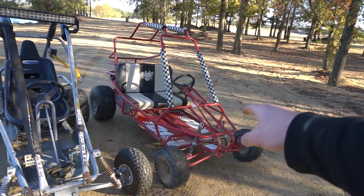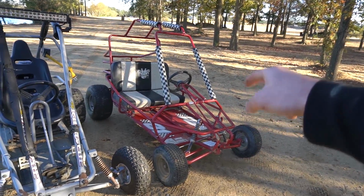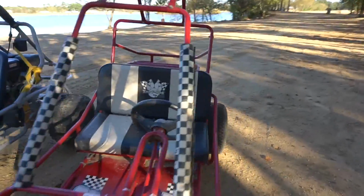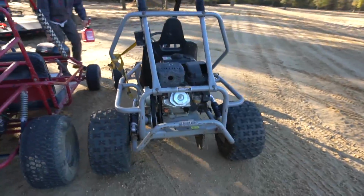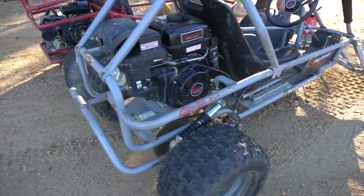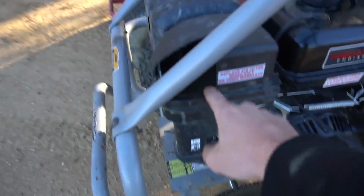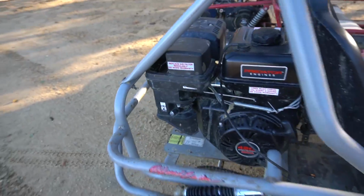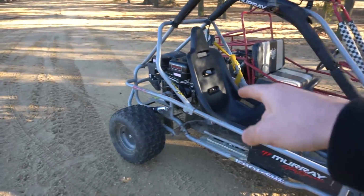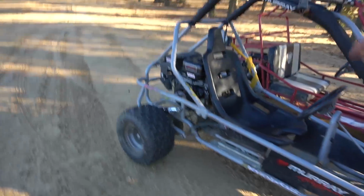Yerf Dog: Subaru 9-horsepower engine, governor removed, Go Power Sports air intake and header and RLV racing muffler. Predator 420 on the Murray with a governor. Completely stock 420 except for this little air filter mod for clearance purposes. Still a pull start. Should be interesting. It's got a lot more displacement here, but this is a stock engine. I still think the Murray is going to win in a drag race, at least until they reach top speed.